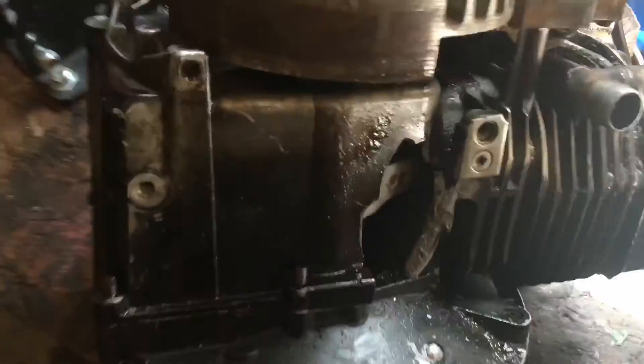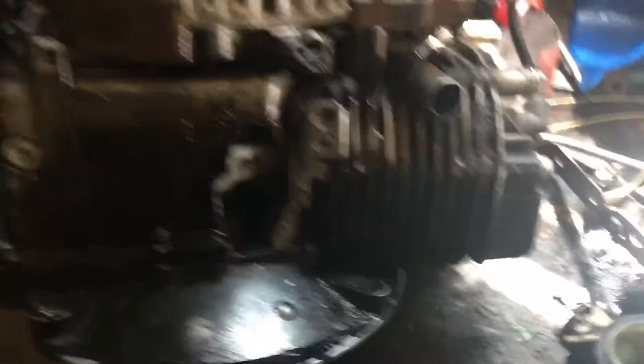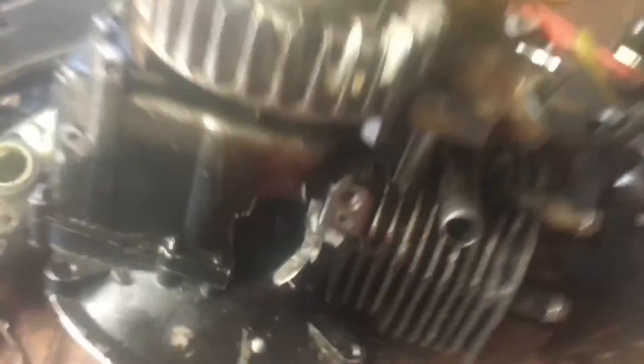I got it all assembled here, got the air shroud in the back. I'm trying to figure out if I'm gonna put this carburetor on it or this one, but it's kind of gonna be in the way, so I'm leaning towards putting this one. I'll figure out a way to bolt her on, then we'll be ready to run her. Here's the moment of truth — we will see if the engine with a hole in the side will run. I got a little bit different way to start, using an impact and some carb spray, just spray it in there and see if she goes.